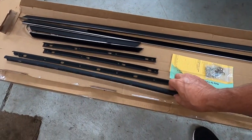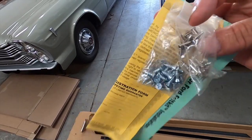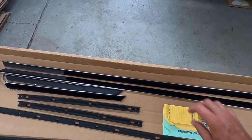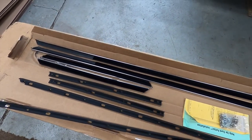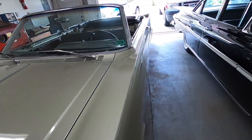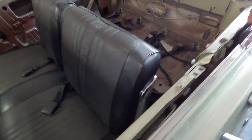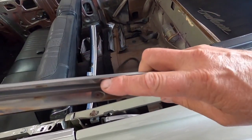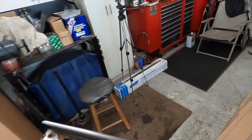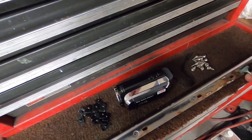This is what I've got to replace on that stainless steel trim — I'm in the process of buffing it. It comes with all the stuff for the trim to attach: the staples that go on the door panels, the rear quarter window panels, interior panels, and exterior pieces. So everything for the windows will be new. I was buffing this piece here and these are the little rivets I've got to grind off — there's no way I'm getting my regular grinder in there, so I've got a little grinding wheel for my Dremel that'll get in there and just grind those heads off.